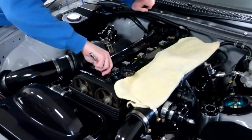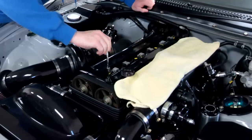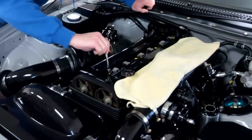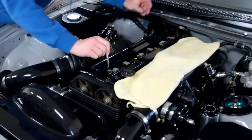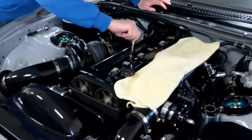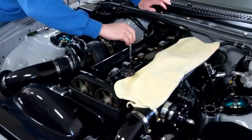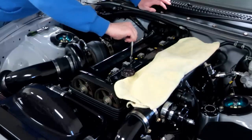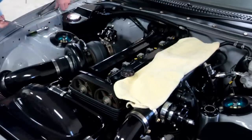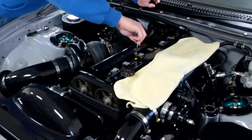One other thing I wanted to mention — pretty much all of the bolt holes that hold down the coil packs on my head are stripped, except for the first two. I actually had to get slightly longer bolts to get as much grip as I could. One is completely gone — I'm going to have to drill, tap it, and put an insert in it. If you guys can give me some feedback on that, appreciate it. I always do everything by hand when installing spark plugs, just to be safe. Not worth the chance of damaging the head even more.